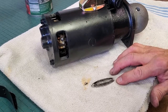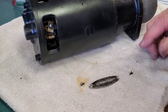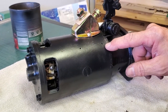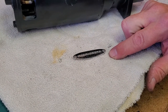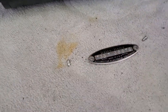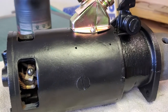Here we have the original tag from the starter — kind of beat up and unusable. We also have the original drive nails or drive screws; they go in two holes, one here and one on the side of the starter. We've got brand new ones to install, as well as brand new tags stamped with all the information. The drive screws have a teeth pattern sort of like a screw on them, and we're going to drive them into the holes with a little ball-peen hammer.